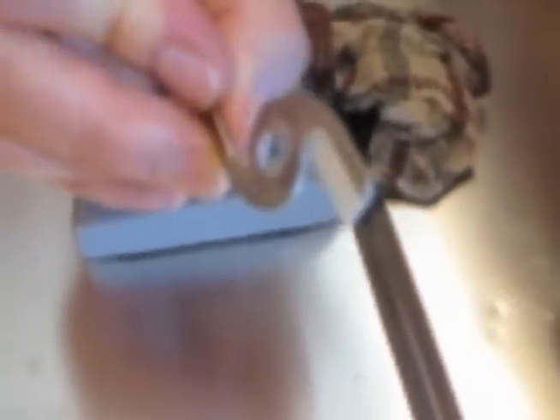Then we have another washer, and then the chopper blade. Notice that it has the part that sticks out in the middle — that will go on the outside so it can spin, and then the cap goes over that. On your inlet cover there is a slot that the cap will slide into. The first step is to put the shaft, spring, and first washer behind the chopper screen assembly, then slide that screen down into place while carefully connecting the shaft to the shaft inside the dishwasher. You can see the slot holds the screen securely in place.